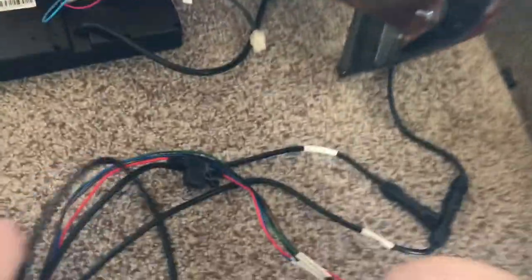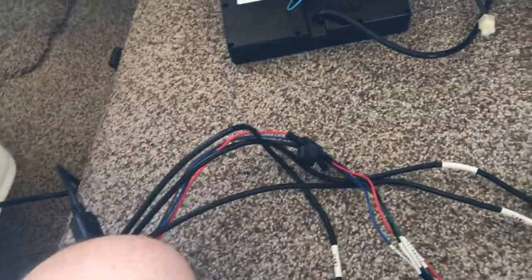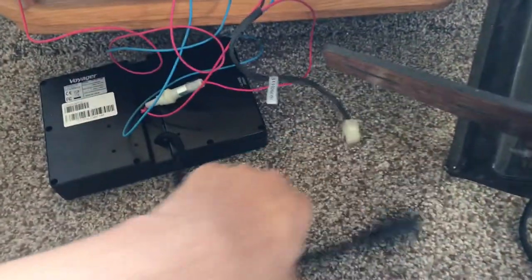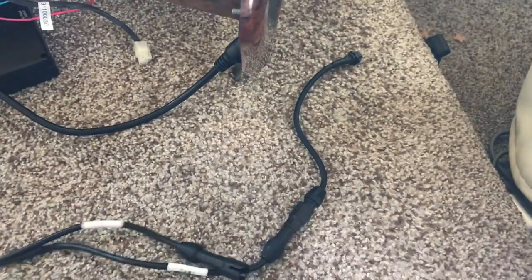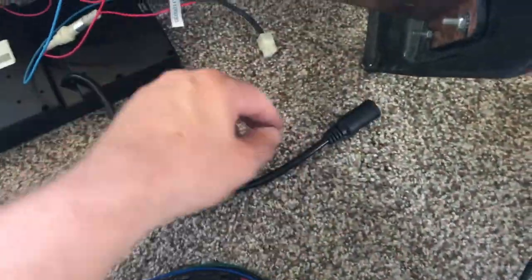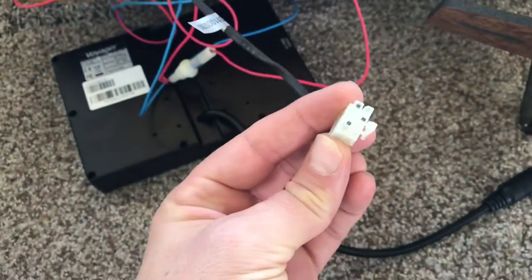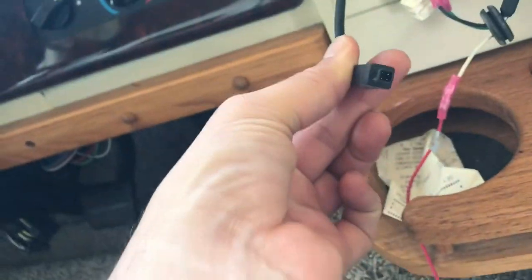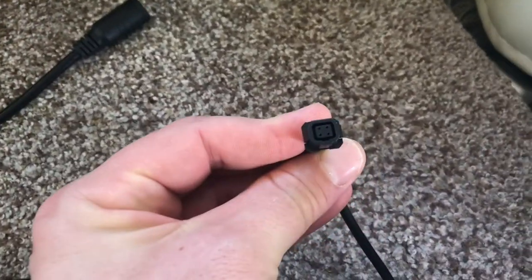I've got the old monitor out and set aside. Now I'm figuring out the wiring harness that came with the new unit. It looks like one end will go into the new LED monitor, and then there are multiple camera hookups and a power connector. When I unplugged things, it looks like this is the power that was going directly into the old monitor, so I can just plug these two together for power to the LED. Then I need to trace back one of these camera plugs — I think that's the one originally plugged into the old monitor.